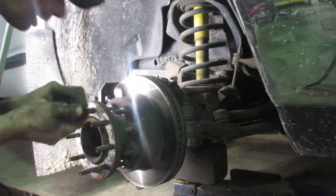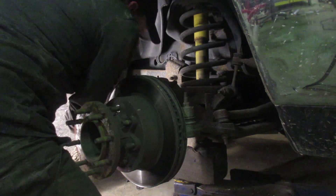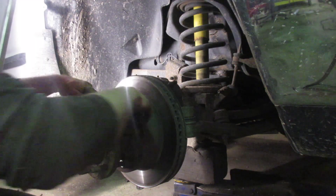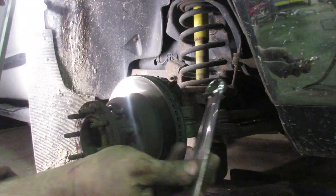Slide the caliper off and lay it to the side — it's a good idea to put a zip tie on that. Gary, go get me a zip tie. Then take your 7/8 nuts off slow and steady with a wrench. Not rocket science.